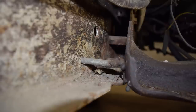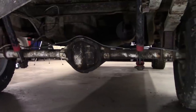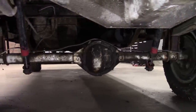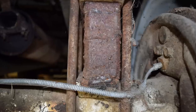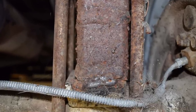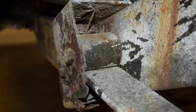Obviously there's some leakage, there's a staggering amount of play in the shift linkage, and what's up with the way the crossmember is mounted? Moving to the back is where things start to actually get ugly. That's a Dana 44 — not a terrible axle — but look at those lift blocks. Not only are they homemade and welded together, they've actually been welded to the spring perch. So that's no good. And what's also not good is that pinion angle. There's a typical J truck problem here in that the driver's side forward spring hanger is getting pretty rotten.